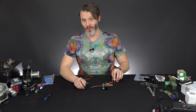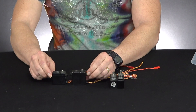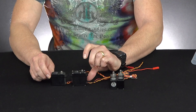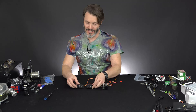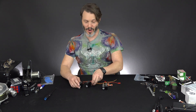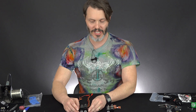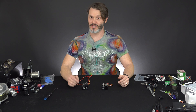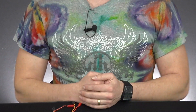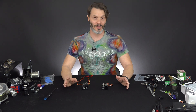Let's take a look at version 2 versus version 3. As you can see it is a little bit bigger — really only a millimeter larger in height and in thickness — but all of that extra size goes into beefier gears, and that's really what we wanted to work on. We really wanted to make sure that we had the most robust gears possible, because that is really what most people in the rock crawler world have problems with. We don't have servo savers on our rigs, we just pound the rigs on the rock all day long. With U4 racers going fast and running into rocks at 20 miles an hour, people are going to break gears.